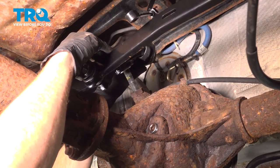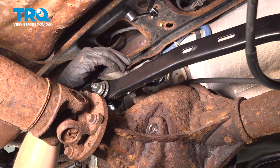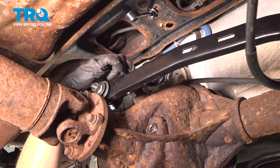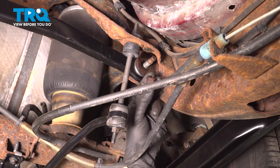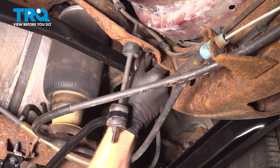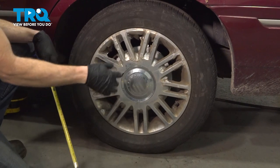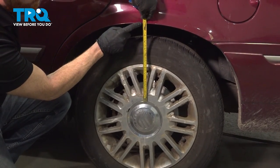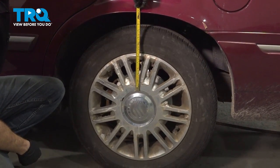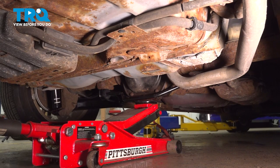Get this lined up with the center pivot stud and start on that mounting nut. Make your way to the driver's side and start on the mounting nut there as well. Before we continue tightening the mounting hardware, let's make our way out and double check the measurement — you want to make sure that you're at the original ride height position. That looks pretty much perfect. To gain extra room underneath the vehicle to tighten your mounting hardware, put a jack underneath your rear differential. Carefully start jacking it up and make sure you're still at the proper measurement between the wheel and the fender, then go ahead and start snugging up your mounting hardware.